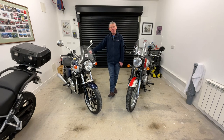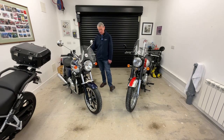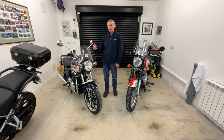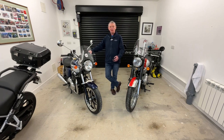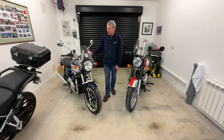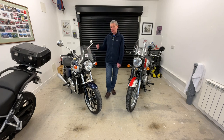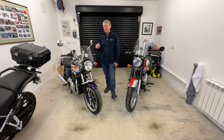I don't know if anybody follows Freddy Dobbs, quite a YouTuber who runs a Bonneville. For a long time he had trouble starting his Bonneville. What he would tend to do is take the side cover off, get into the starter solenoid, and short the solenoid out with a screwdriver, and the bike would fire up. You'd say to yourself, that's weird — if a bike can start that way, there's obviously nothing wrong with the battery. In the end, he bought a brand new battery and it seemed to cure the problems. I reckon what was happening was that the battery potentially wasn't brilliant, but there was enough power to turn the engine over; it was the ECU that was stopping the solenoid from activating and starting the bike.